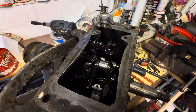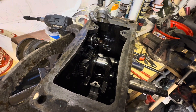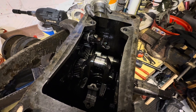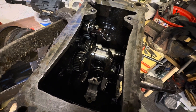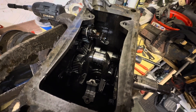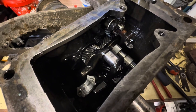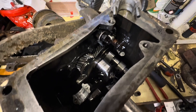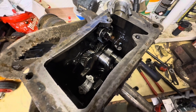We're going to go a little bit further tonight and see what we find. Well, unfortunately we've found the damage and it's not anything at the top of the engine. Despite the lack of heat in all the crankshaft and everything when it was running, we do have some damage to the big end bearing — only in one particular place. Something's got in there somehow; can't even see anything that was really in there that caused all of this damage. But it's only in one particular spot. I think we can probably clean up that big end cap and the crankshaft journal there, give that a polish — this will run again, it's not a problem.